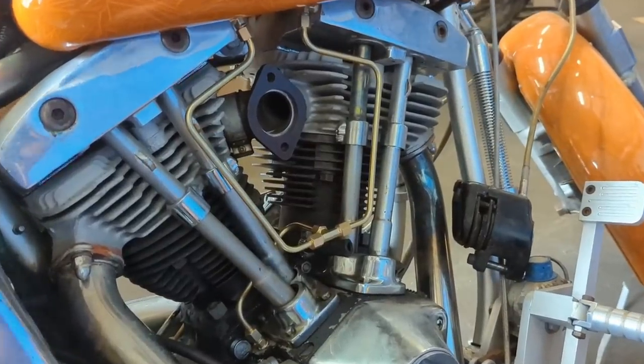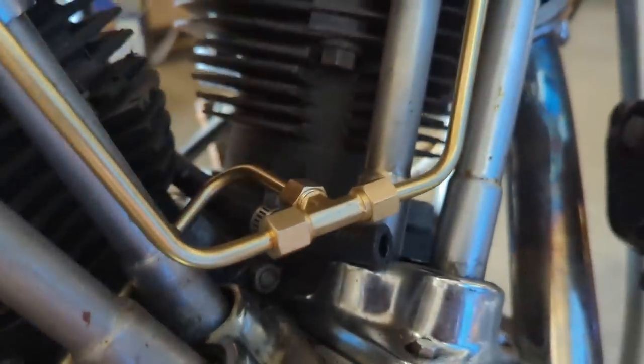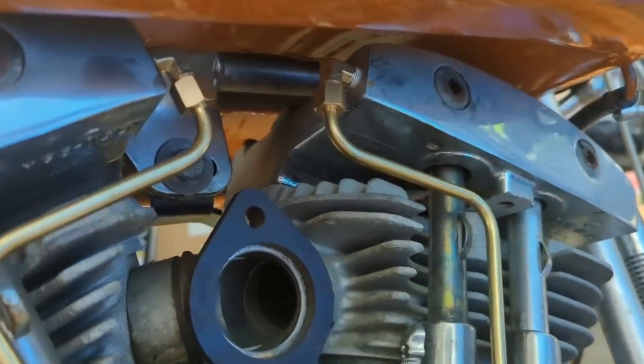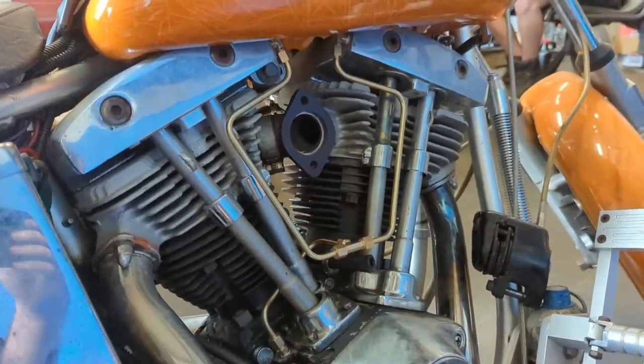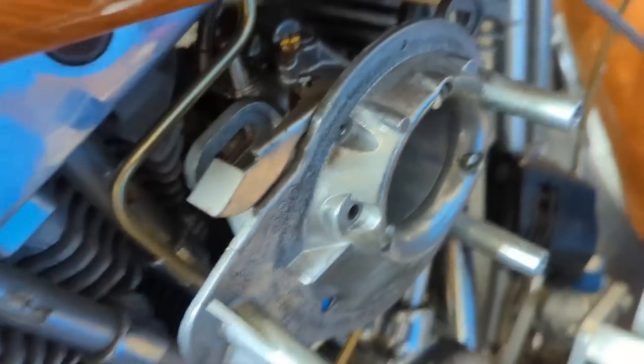I've also heard — I don't know if there's any truth to this — that running the oil lines that way is better for oil distribution to the rocker boxes. Instead of having to pass through the back cylinder rocker box and then go through the oil line to the front cylinder's rocker box, they just come up the middle and they both get oil equally at the same time on a cold start. Really, I'm just doing it because I think braided stainless is cheesy. I got the oil feed lines changed out — pulling the old braided stainless stuff out was pretty straightforward. The kit came from Lowbrow Customs and it went on very simply.